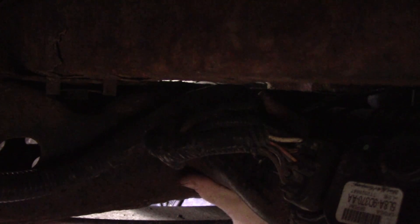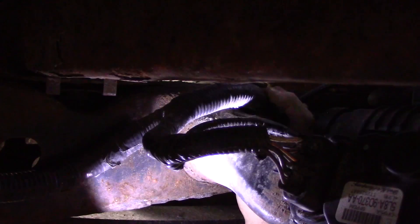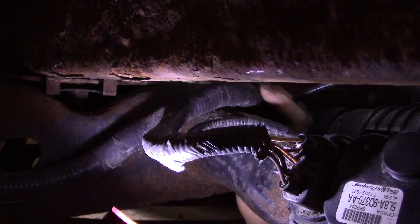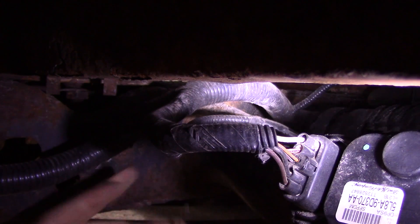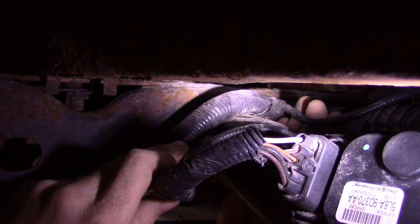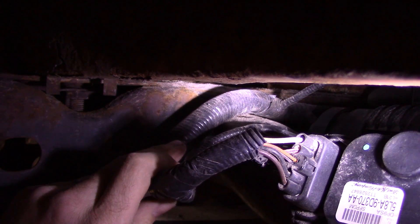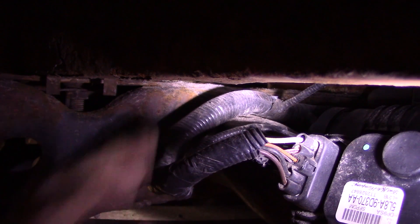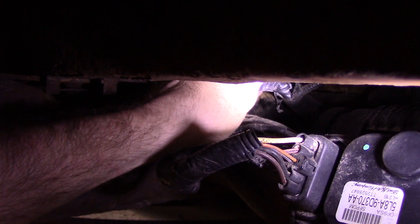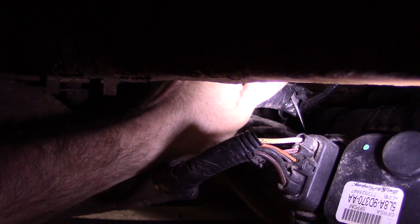I'm just taking this harness and getting these huge changes — two and a half volts right now, down to about 1.5. I think I'm going to rip it open right here. These are actually the wires that go to the vent solenoid harness, so I definitely want to stay in that area. My voltage is down to 1.3, 1.1 — keeps changing. I got to be close.